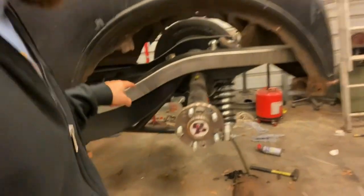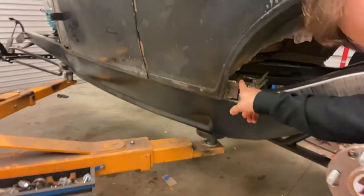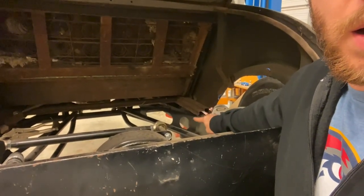I started on this, and this is what I'm gonna move on to with the next video, making the sub rails where it ties in here. Let's see, bring it into this, because this is where the sub rail goes to. It starts here and it goes here, and I can come around so you can see better, right there. Then you have to tie it in. But in the Model A's frame configuration, there's not that kick up, so you can go in a straight line, and you can't do that with the 32 chassis.